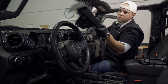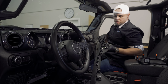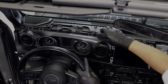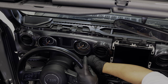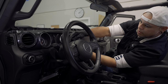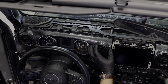Sometimes it's easier to work yourself around to the driver's side so you can pull evenly. There you can see all those metal clips on the back after you get your dash trim removed. The gauge bezel here has four screws on the top holding it on and then it's just clips on the bottom. Once we remove these four screws you'll be able to pop this whole panel off. I like to have the steering wheel in the lowest position to give you as much access as possible.